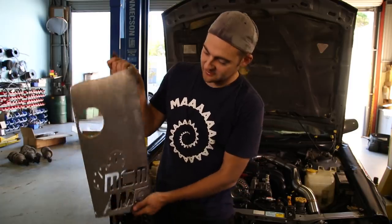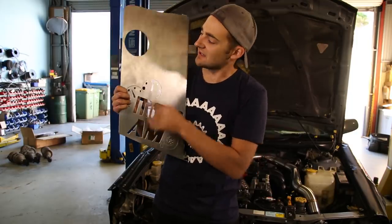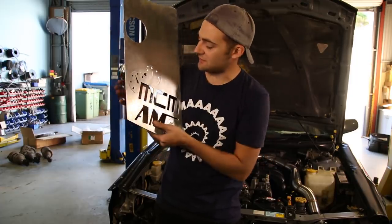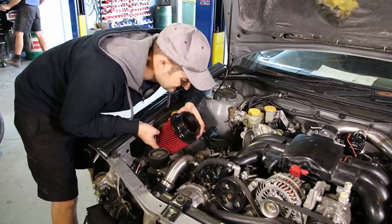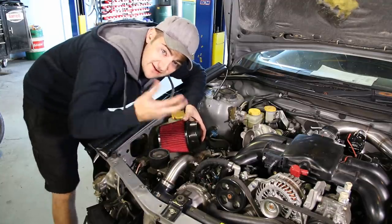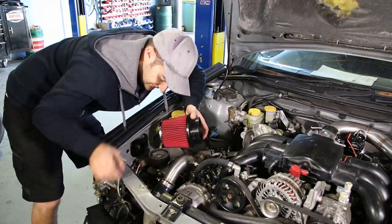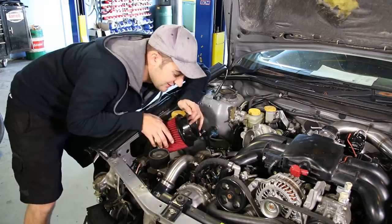Something that's been happening with this build is that people have been coming past, looking at the car getting excited, and then making stuff. One of Turbo Yoda's mates who is a machinist slash engineer slash everything made this awesome cover that's going to go over the air box, and also has a cut-out for the power steering reservoir, which looks freaking awesome. We might do something cool with painting it but for now we're just going to stick it on there. Then we're going to mock up our air intake. This is one of those occasions where it's more about packaging than anything else. The pod filter means we can fit it here. We could go in the guard but that can leave you open to getting dust, dirt, and water up into your intake - it's probably safer up here in the engine bay. We do get a bit of cold air from the headlight. No airflow meters because we've got a Haltech and we've got a MAP sensor.